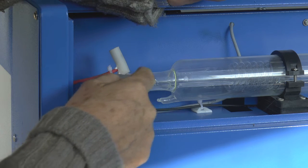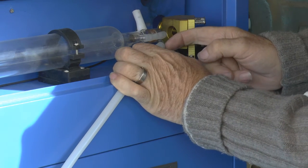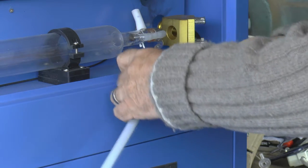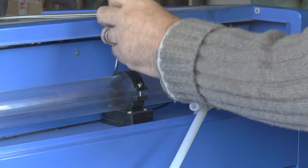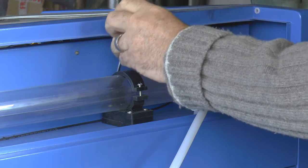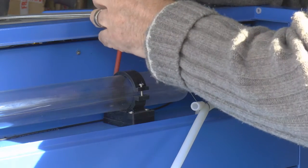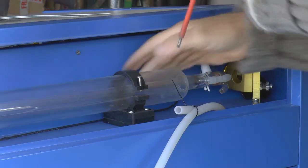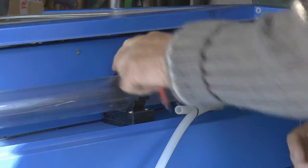I don't know whether the tube I've got will have this connection on it already — we shall have to wait and see. I'll disconnect the tube at the other end as well, similar sort of arrangement, pulling the tube and at the same time pushing it with my fingernail. There's going to be a tendency for that tube to drop back and disappear inside the machine, so I'm going to put a tie wrap around these two pieces. There's a clamp on this end; the screw at the back is a bit difficult to get to, so with a long electrical screwdriver — there's a slot as well as a Phillips head — we can just about tease it out. I think there's a nut underneath there which makes life very difficult, so we'll just persevere and see if we can get the nut to fall off, which we have now.